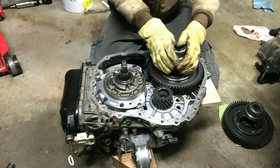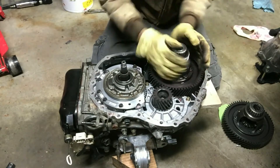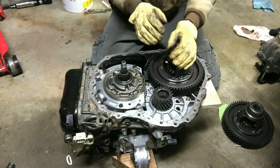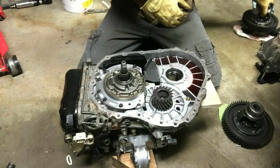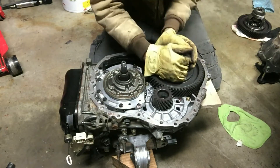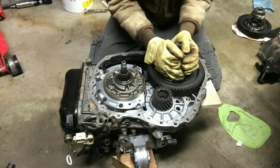I've got gloves on because there are some sharp edges, but just turning this by hand with the shifter in neutral - that is the sound it was making. I never got it over ten miles an hour driving down my driveway and down the street a little ways before it got really noisy. I never thought about the wear difference between the two. Swapping in the differential with only 95,000 miles, you can feel just a little bit of tooth chatter, but some of that may be because the other end isn't supported by a bearing and is flexing slightly - but it's way quieter.